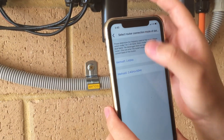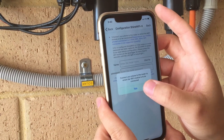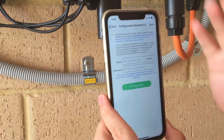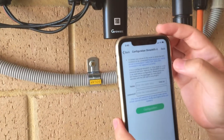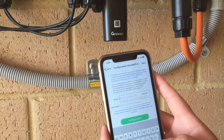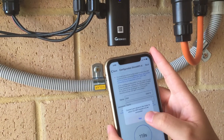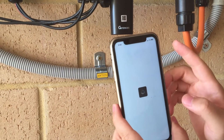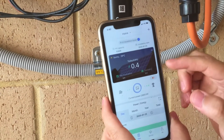Make sure you select the 2.4 gigahertz network here, because we've already connected the dongle to the Wi-Fi in the first stage and the blue light is flashing. You can basically type anything here just to go to the next page. Click yes and then don't wait for the countdown — just click back and you should see your figures displayed on your dashboard.